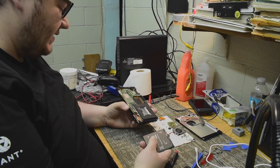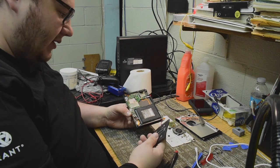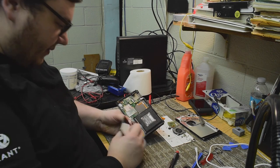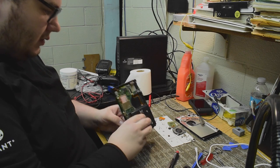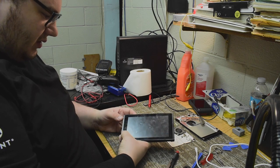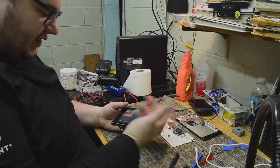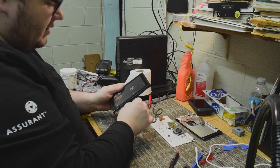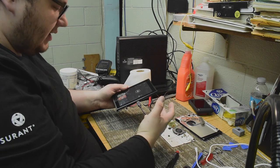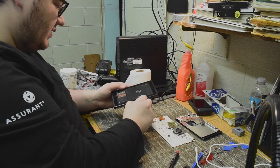I have the switch together enough to test. I don't have my USB amp meter with me at the moment, so I'm going to put a known good battery in this switch and check if it turns on. We'll take our known good battery, plug it in, and hit the power button. Nintendo logo — that's good, it's booting. Touch doesn't work because I don't have the touch hooked up — I always do that. And it does charge, which is good. Obviously we can't test how many amps it's drawing, but I'm assuming it's going to work. Let's plug it in the other way just to make sure it charges both ways — and it does, which is good.